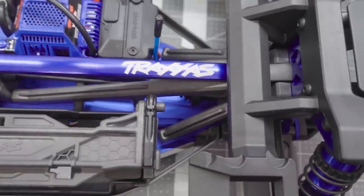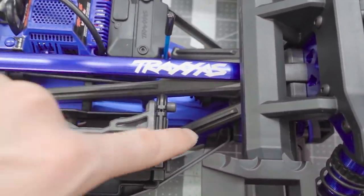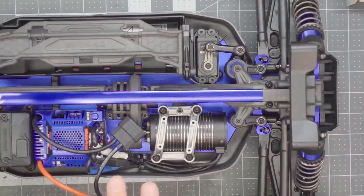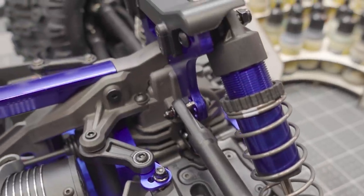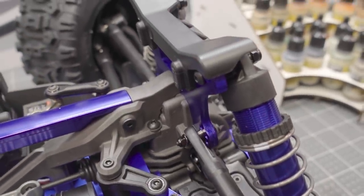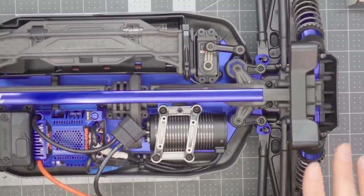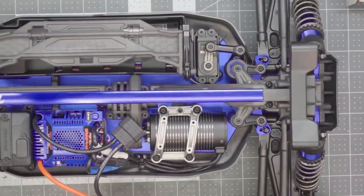They're sort of a composite plastic. In the rear, there are four mounting points for that one. In the front, there are two additional mounting points. Very strong. Everything ties into these 4.5 millimeter or so stamped aluminum shock towers. Very robust, very beefy, and certainly, I think, going to be a very strong truck in that regard.